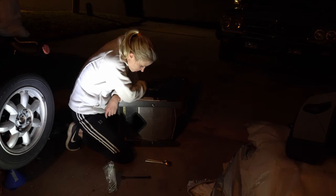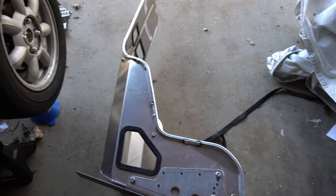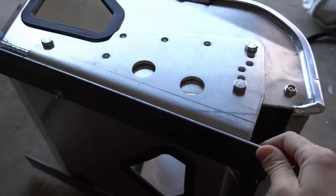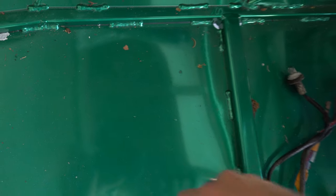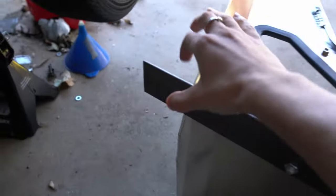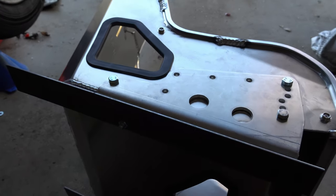I'm currently pondering if this nut and bolt combo is going to be short enough to give me the clearance I need for the floor pan. I've got the Kirkey 55 series seat here, and I'm also using the Kirkey side mounting bracket that is separate. I'm running an eighth-of-an-inch steel plate below to mount this to the square tube on the chassis. I have a bottom mount that I made sure is short enough to fit in between the square tube and the floor. That bolt's going to sit just above the steel floor — I don't want to drill into that, but I've made sure it's short enough. So what I'm going to do now is put this back in the car to figure out where I want to mount on these steel tubes for the front and end of the steel plate, and once I get those measurements I'll drill that out, remove the side bracket from the seat to access the front bolt, and hopefully I'll have a seat in the car.